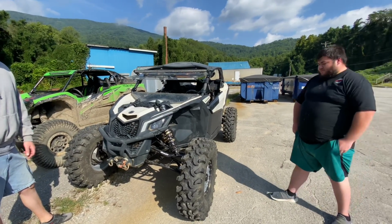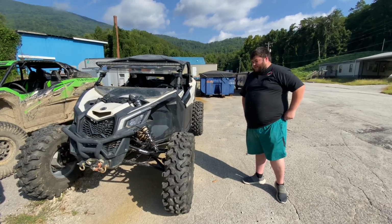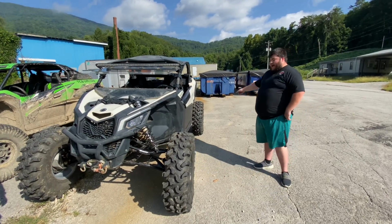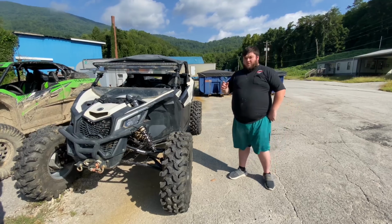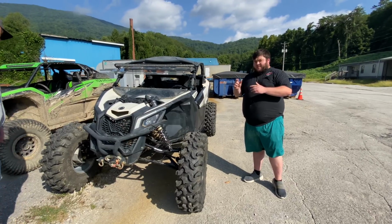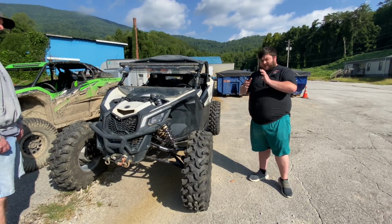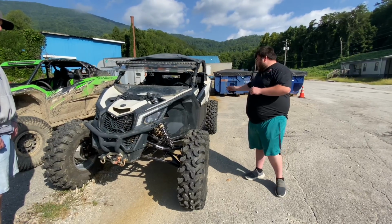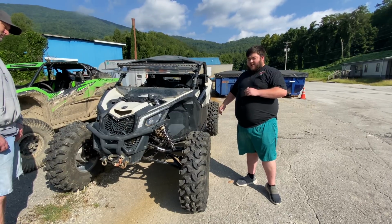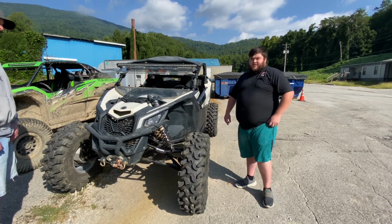One important thing to let you guys know is I went with the 6-1 wheel on these Can-Ams, so I'm only 73 inches wide. On the back, though, they won't work with the 6-1 wheel. It'll actually rub the tire. We had to make a 6-millimeter billet spacer with the plasma cutter. So in the back, it's almost level to a 5-2 wheel. So just for you guys knowing, to run portals, a 6-1 wheel will rub on the rear portal bracket. So just to let you guys know.